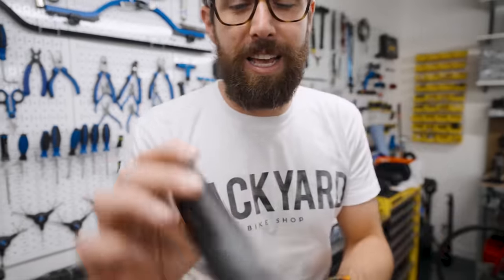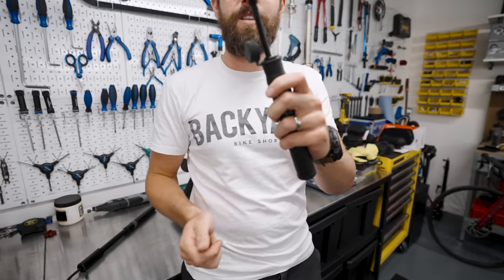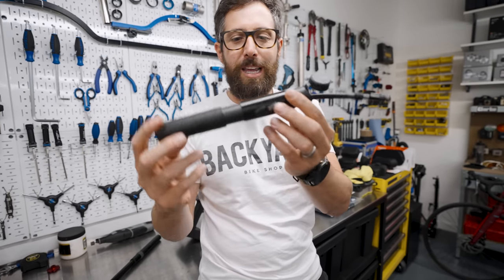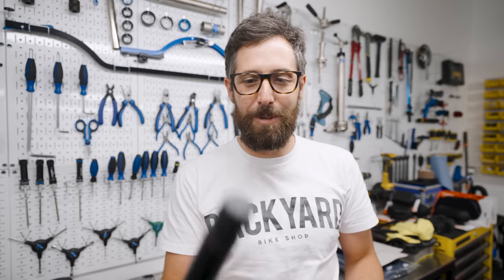There are other options just as good and not as expensive, like the SKS Airflex. Really good, just got a cup on there — pull it out. There are loads of other versions where you have to unscrew everything, but this is just really easy. High volume because nobody's running really high pressures anymore. Also, CO2 cartridges on sealant is not a good idea — just stop doing it. You can use CO2 in an emergency, but if you need to put a bit in, use a hand pump. Trust me — your sealant will last much longer and your bike will be a lot happier.